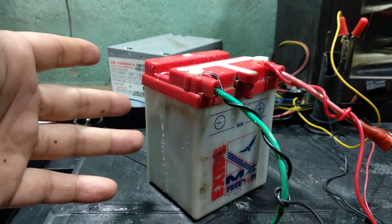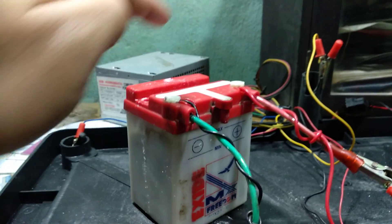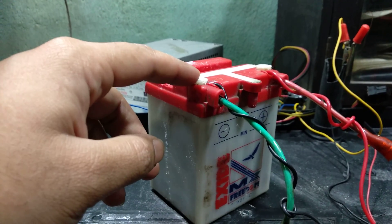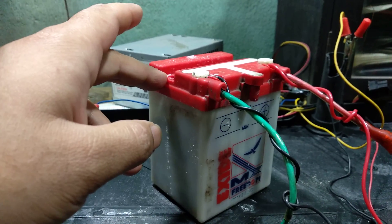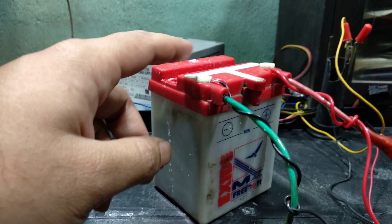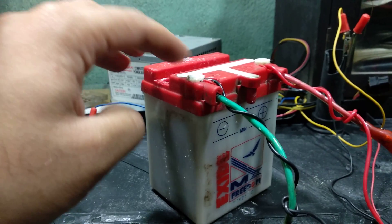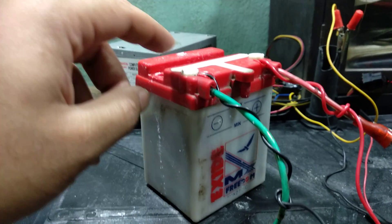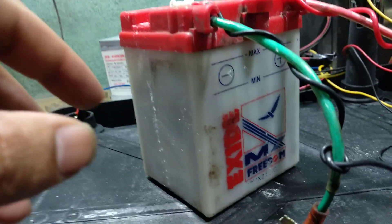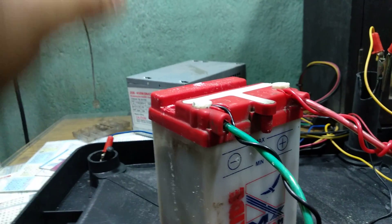So I directly cleaned it up with baking soda to neutralize the acids inside, cleaned it twice thoroughly. Finally I tried once with the acid, but that time I didn't clean these two points, so I am not sure whether it was due to sulfation on the plates causing the charging issue, or whether it was these two soldered but dirty points with acid accumulation. Now it's working.